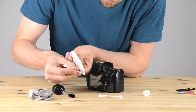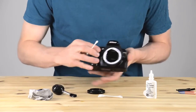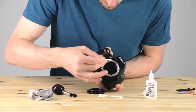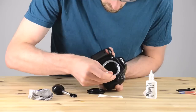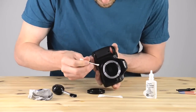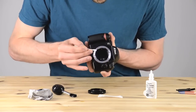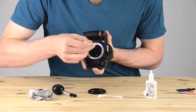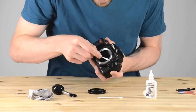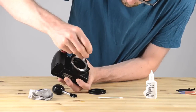Now I'm going back to the mount. We cleaned it off the first time with the hard brush, and now we're coming back with a Q-tip to run it around the edge of the mount. I'm not using a lot of lens cleaning fluid — I do not want anything to drip inside this camera. Anything going near the opening of your camera should be just a lightly dampened Q-tip or material tool, unless you want to turn your camera into a paperweight. This spot gets dirty because dust lands on the edge of the lens and camera and then falls into the mount when you take the lens on and off. This is all sped up — you're seeing a time-lapse version of this cleaning job.